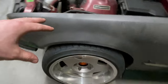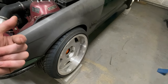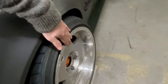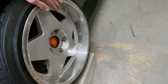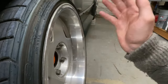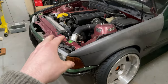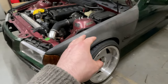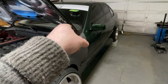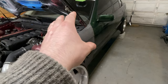I'm going to dial back some camber. I'll get my baseline measurement using my iPhone's angle finder — I'll put a flat piece of metal onto the wheel, put the angle finder on it, and get a baseline of where my camber angle is on the front wheels. Then I'll take the boots off my steering rack, measure center lock to lock, and make sure we're centered on the rack. We don't care what the steering wheel looks like — once we're done with alignment we'll move it to where it should be.